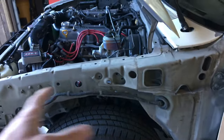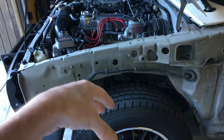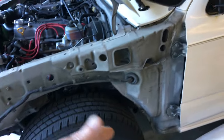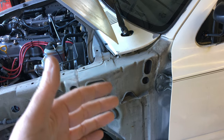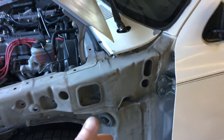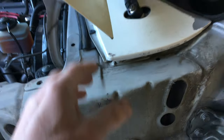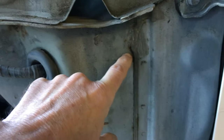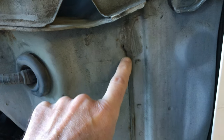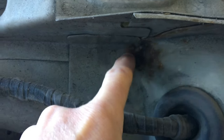Just for anyone who's curious how to get a fender off — it's actually very straightforward. Just a 10 millimeter wrench, pop the nuts off, and the fender just lifts straight out. For anyone who may be having water leaking into the cabin and dripping down on the carpet or floor mats, you can see there are body seams that have to be sealed here, and that could allow water to get in. I saw on some forums people had rust in this area. In my case, I have a feeling it's either this area here, which is kind of lifted and separated, or it's this very suspicious little rust hole here, maybe letting water get in.